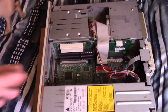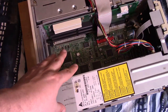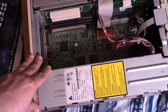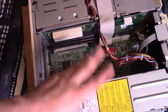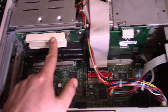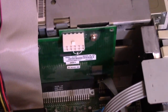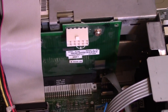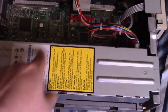All right, here we are with the case top off. Kind of a proprietary design. I don't believe this is NLX form factor. I have a machine we'll go over NLX in a future video, but I think this predates that, so I think this is just some kind of HP proprietary motherboard design form factor here. We have a riser card for the expansion cards. There's a little power connector here, but I've tested this thing, at least to POST, and it works fine. I don't think we need that, maybe with certain cards, but the proprietary form factor power supply does not have that connection, so...